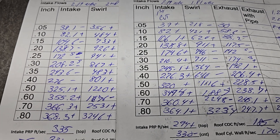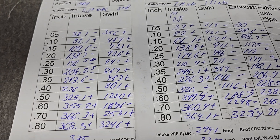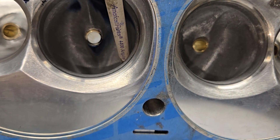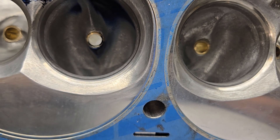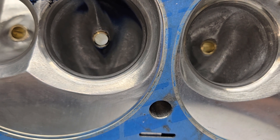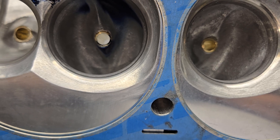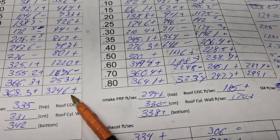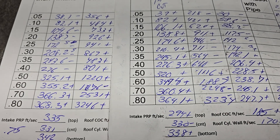Let's go over our swirls - they're interesting. Would I have expected it to go in that direction? Yes, because the CSA expansion was all done on this side of the port all the way to the valve face, the manifold face. Couldn't do any more on the pushrod side - pushed my luck and that's it. Did I take some out of the roof? You bet. The sonic was showing me spots that should definitely be solid but weren't solid - am I going to take a chance on this expensive head? Nope. So that's why we have the CSA we have. If we go 600 plus to 700 lift we've got more than enough swirl and a nice progression - I think it's going to work out just fine.